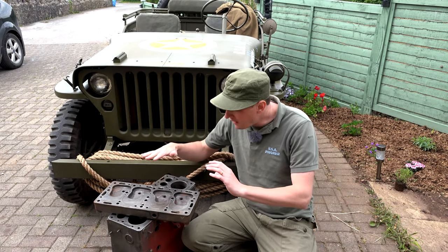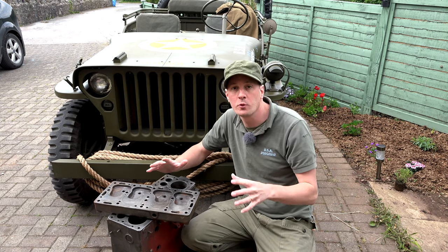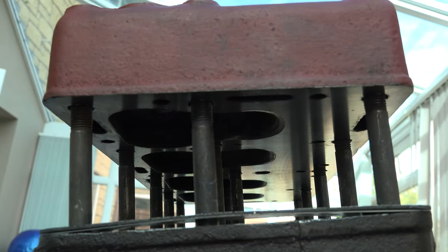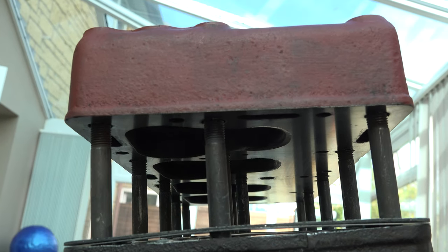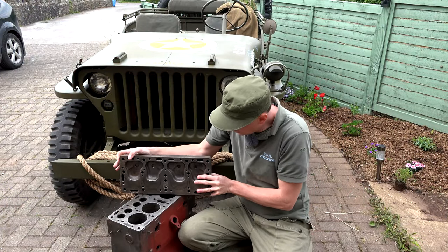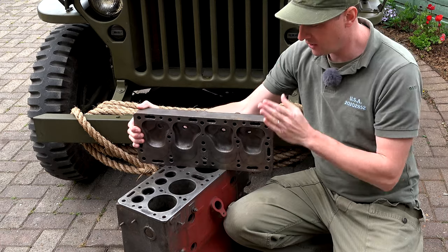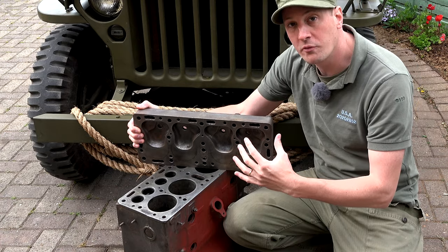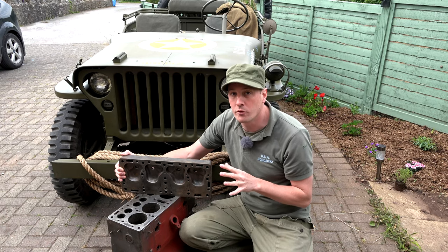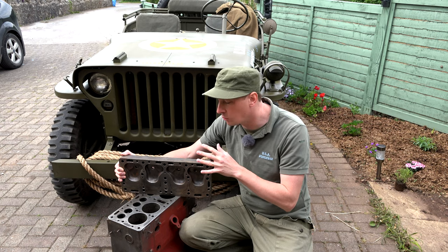Let's talk heads. You're out at a swap meet or browsing heads online and you see one you want to buy and fit to your Jeep. You've got pictures from the seller and it all looks beautiful, shiny and clean, but how much has the seller taken off beforehand? Is the head still usable? What we're talking about is: with your spark plug in here and the two valves right here, if you take off too much meat off the head, the spark plug will move down towards the head and towards the valve, and you could have a problem where the spark plug hits the top of the valves. It doesn't seem to be a massive problem with L134 engines, but it's an interesting thing to look at.